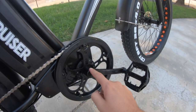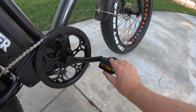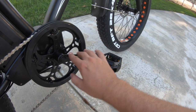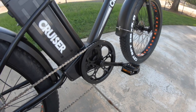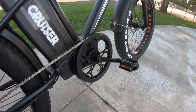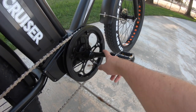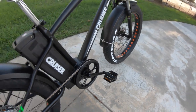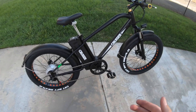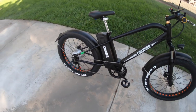The cranks are 150-millimeter. The pedals are nothing too special — alloy aluminum so they'll last a long time. Usually you see 170-millimeter cranks for a normal size, so at 150 these are short. If you have longer legs, like a 34-inch inseam, these are going to feel like you're tiptoeing. If you're a shorter rider, it might be a good fit. Fortunately it's a fairly universal square-taper part so you could switch that out, though you'd need a specialty tool — a bike shop would handle it.